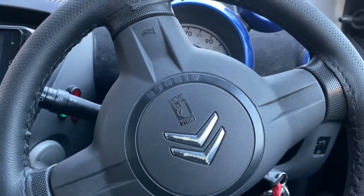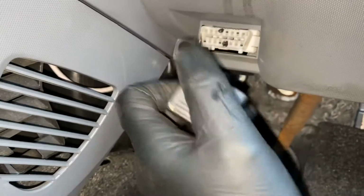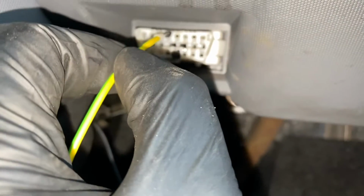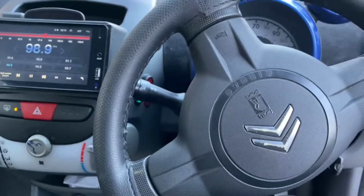So let's try and program that ECU to receive this key. And this bit now involves the paper clip or the piece of wire I've got. So I need to unplug that because I don't need that plugged in. And if you notice there, I've marked the two pins, but it's number 4 and 13, which I will lovingly put in a brilliant on-screen diagram now. So what I've got to do is, first, turn the ignition on. Secondly, I need to put this to short between there and there. And now I need to leave it for 35 minutes, I believe, with the ignition still turned on.